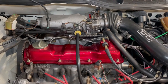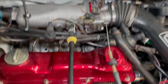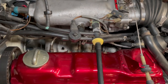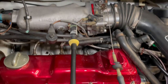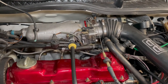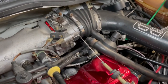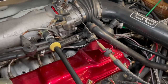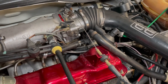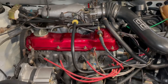And again, I don't know if that's the throttle body itself, but as part of this I also redid the injectors. I cleaned up the fuel injectors and resealed them. Same thing, cleaned up the throttle body, cleaned everything I had a chance to clean. But that's really it. I'll do more of a road test video soon, as soon as we have some decent weather, take the cabbie out, and I'll do a walkthrough of the whole car. But there you go.